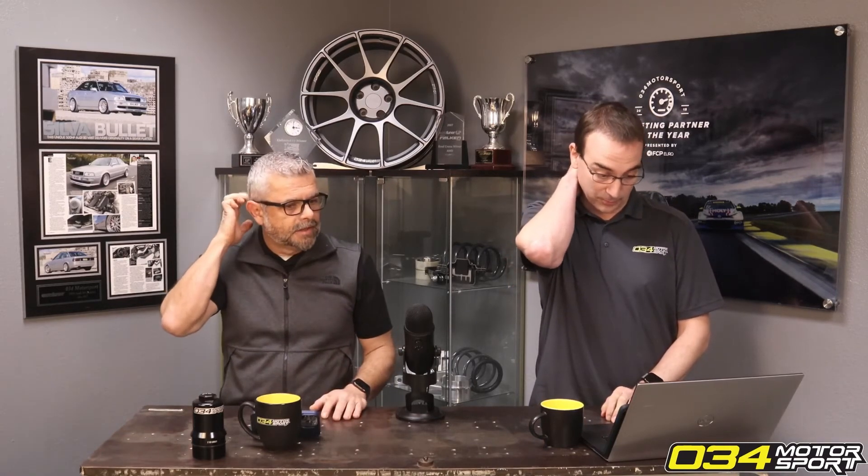Our tunes are designed to function on the E85 file as long as your ethanol content is above about E60 to E65, so don't stress about being right at E85 — you probably won't ever see exactly E85. What we typically see is content lower than E85, and that's okay. The pump may even say the mid-content is like E70 or E60. As long as you're seeing E70 to E85 you're golden. Actually having slightly less ethanol is a good thing because it means your fuel system won't be quite as stressed.